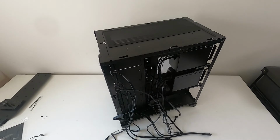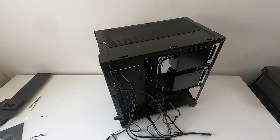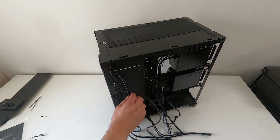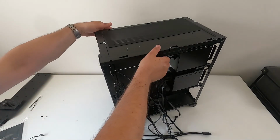Because when you're building it yourself, getting everything to work isn't quite the same as if you buy a computer. If you buy a computer, then it's generally expected that everything that you can plug something into works. When you're doing it yourself, you decide whether it matters, don't you? So if you want all 5 USB 3 sockets working, you're going to need to be a bit creative with the motherboard and other accessories that you use in the case to get them working.